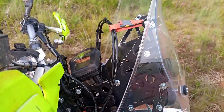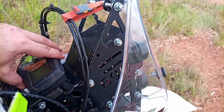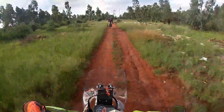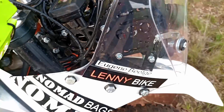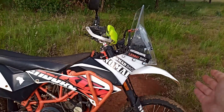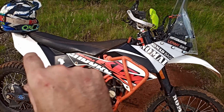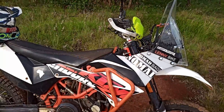Looking at the tower itself, it's made from 4.5mm aluminium — currently only temporarily painted, but I'll get back to that. The display panel is clearly mounted in front for visibility, lifted a little bit higher than the tower, and I've got a whole range of button controls, brackets, and charging points. The indicators are set inside in case you fall, which makes it very convenient. This also forms part of my criteria: to have the bike look as if it's one body piece, and in the new year we'll put on a sticker kit that covers the whole thing to round off the design.